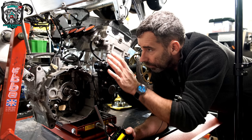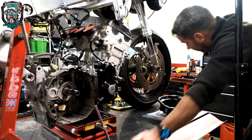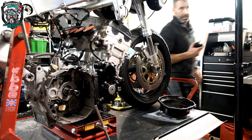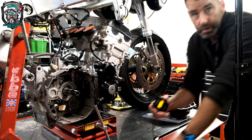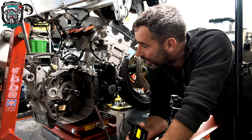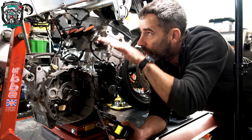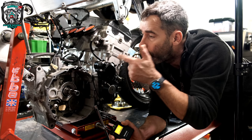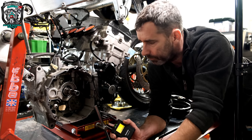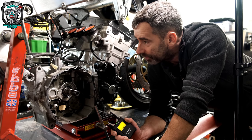So we're going to slowly lift this engine up and line everything up. A compressor — it hasn't been on for hours and it comes on just as I'm starting to speak. I've got the engine bolts ready down here. Slowly lift it in, and once you've got one engine bolt in you can rock the engine backwards and forwards and line everything else up, then torque all the engine bolts up.